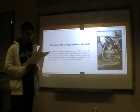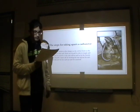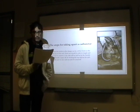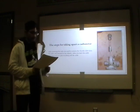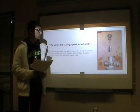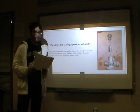Then the carb will be held in by a throttle cable, which is the top piece on the carburetor. The throttle comes off by twisting the top cap on the carb. The carb will now be free and can be removed. After removing the carburetor, you need to remove the throttle slide from the cable. This is still attached to the vehicle, but in this picture it's already unhooked. Then you can pull everything off the cable.